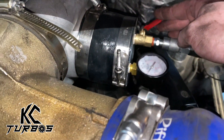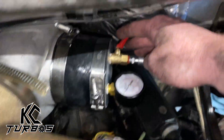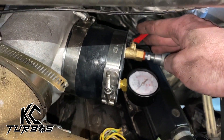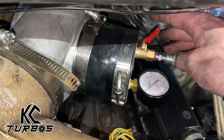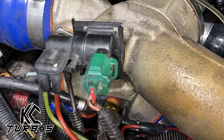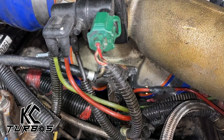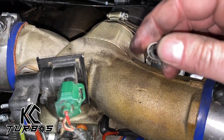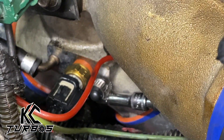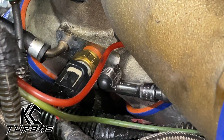When you're searching with the soapy water, you can kind of fill this up and leave the valve open just a little bit, especially if it's dropping pressure. So now I'm keeping the pressure up by having the valve open just a little bit. See how it's just bubbling off of there? It's leaking from there. So what we recommend is putting a plug in there.